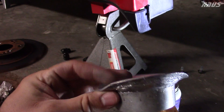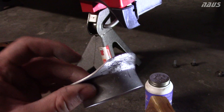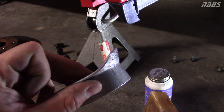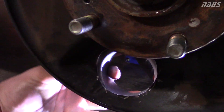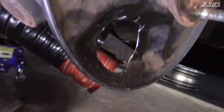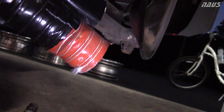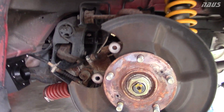I took a pair of vice grips and slowly bent this edge all the way out — it looks rough but you'll never see underneath the car. You really want to flare it out almost flat, maybe a 30-degree angle right now. When you put it behind here you want it to seal all the way up to the face, because the bottom edge of this really contours forward. If you don't want to contort your dust shield you can get away with it pretty cleanly.